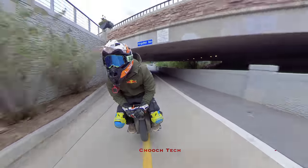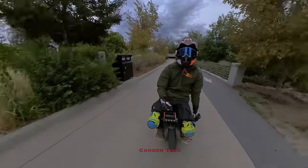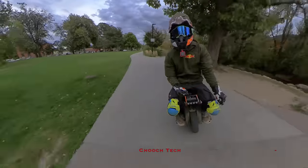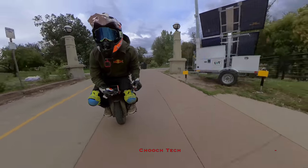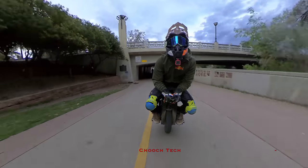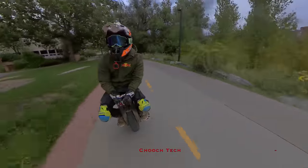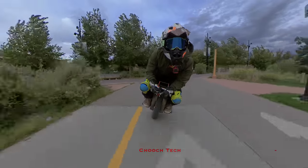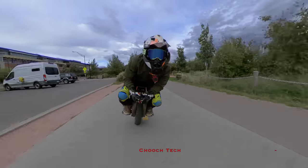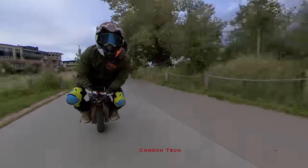You need to know — it looks great, it looks like so much fun right here. But I'm telling you, this thing devours battery. This C40 motor — you can ride it casually at these speeds right here, but a few miles into your ride you're going to look down and be like, where did all my battery go? After you lose a few bars of battery and your voltage dips down, I wouldn't ride this thing below like 111 volts. I really wouldn't. I wouldn't be pushing it, riding it hard if it dropped below like 111 volts.